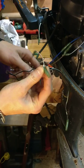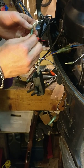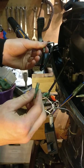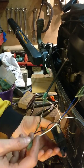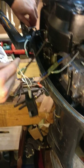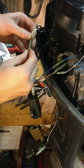Then you're left with three more wires. Your white wire — pure white — is for your kill cord assembly. The engine needs this kill cord assembly plugged in with the switch lifted up to run. However, if you want to test the spark, you can just unplug it and the engine should spark without it. But if you plug it in, you will need the kill cord switch raised before it'll work. So: white wire to the white kill cord lead.